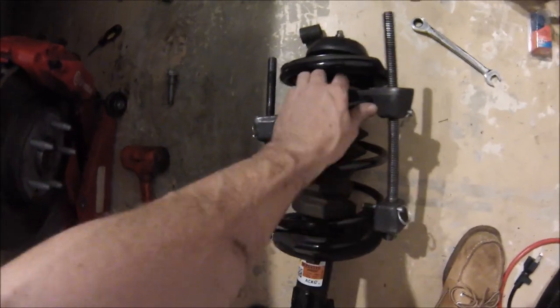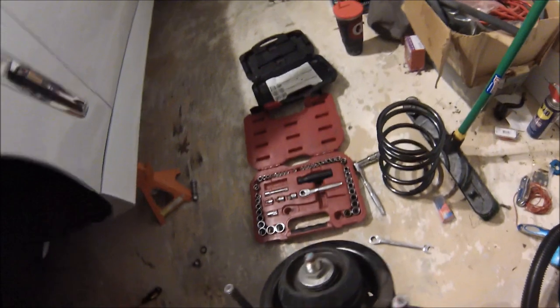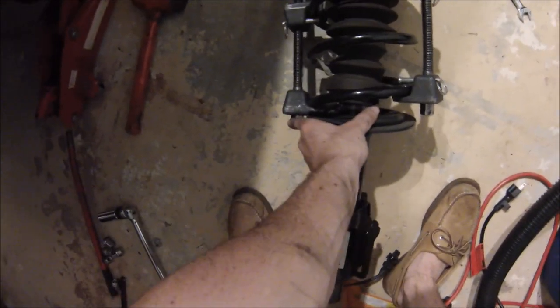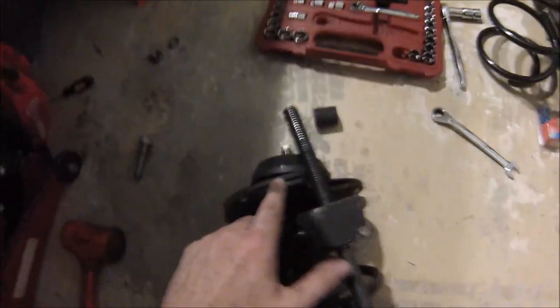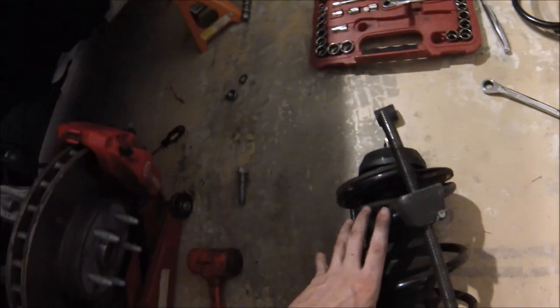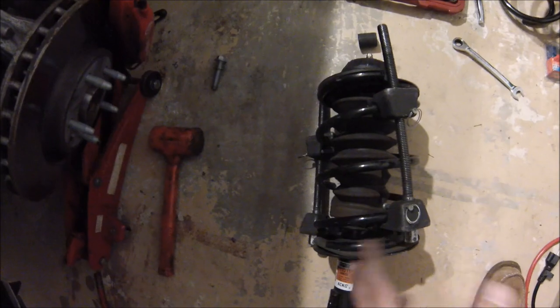Now there's a lot of compression under this. If you took this hat off without compressing the spring, basically the hat would just shoot across the room after it reached the top. There are some pretty tragic stories about what can happen if you do that, so make sure you use a spring compressor. Basically now we're going to tighten these one at a time — maybe five or ten turns here, five or ten turns here — and go back and forth until you see the spring unseat on the hat at the top pigtail. Then we will take the hat off and swap the spring.